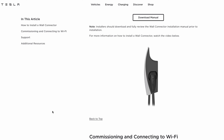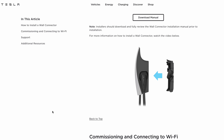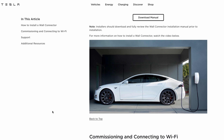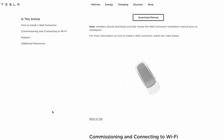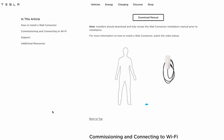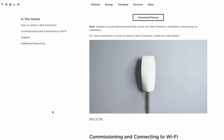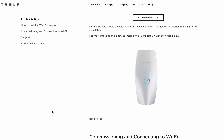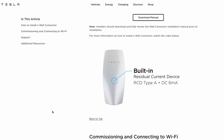The charger is capable of sharing power with another charger if we had two cars and needed to charge both simultaneously. If I needed more power — which I don't — I could apply to have my electricity supply upgraded to three-phase, and the charger could then be reprogrammed to accept up to 22 kilowatts, giving around 45 miles added per hour plugged in. My setting is seven kilowatts, which gives me around 21 miles per hour. So overnight I can easily add 210 miles, covering me from completely flat to almost completely full. The last four years have confirmed this is perfectly adequate for my needs. If it ever isn't, I'll revisit the issue.